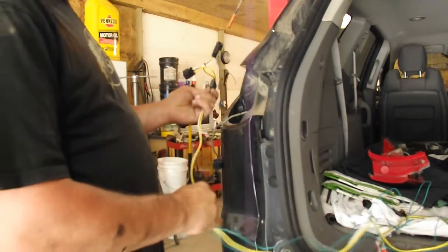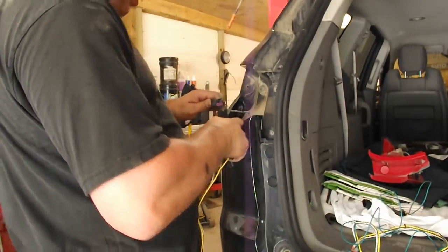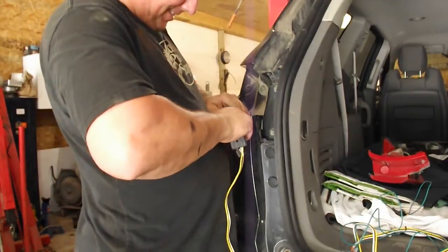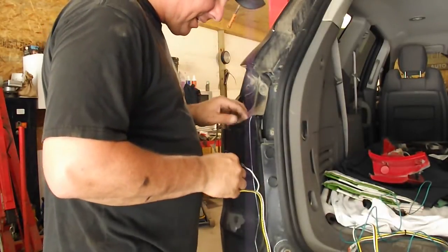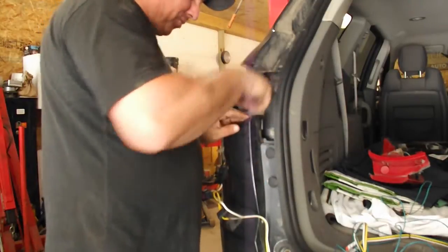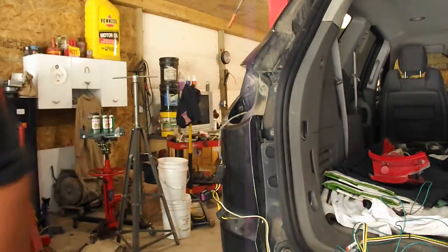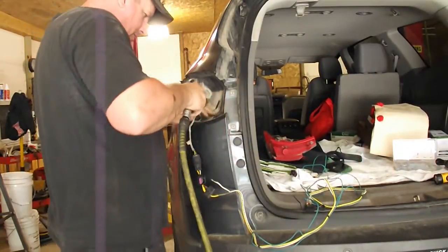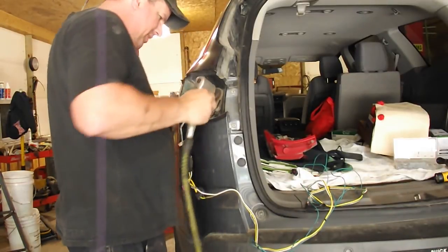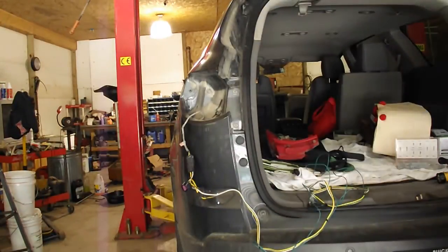The yellow side is the driver side and the green side is the passenger side — get that right or you'll be confusing everybody behind you. This just simply plugs in place right here, and then this end will plug back into the tail light. Before we do that, we're going to establish a ground point inside here and route the rest of the wiring harness down between the rear bumper fascia and the body of the vehicle so we can route it underneath and over to the other tail light. I'll just clean the paint off the spot here so I can get a good ground, run a self-tapper right there with my ground screw, and then put a little bit of paint or silicone over it so we don't create a rust issue down the road.